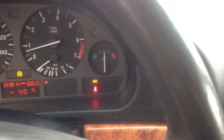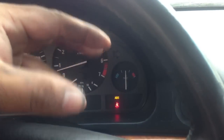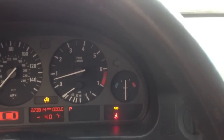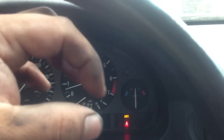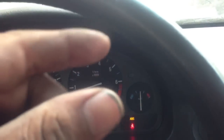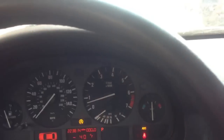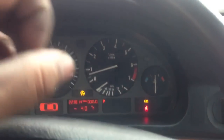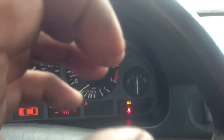So that's just an example of when you need a new thermostat. What's happening in this problem is that the thermostat is not opening on its own because it's just a cheap thermostat — with the hot water in it, it's not opening. So when you step on the gas, you're forcing water through your engine and through your radiator to start flowing and to push the thermostat open. The thermostat is supposed to open automatically.